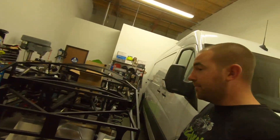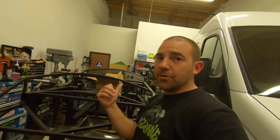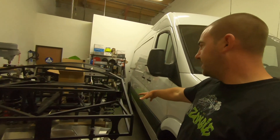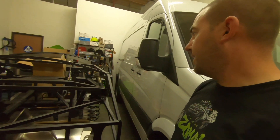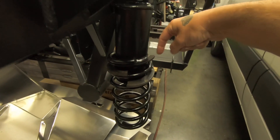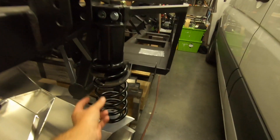In hindsight, now that I've seen this - I didn't know before - I would go coilovers in the rear. If you look on the website, it's like $500 for the upgrade to coilovers in the rear, and that's what I would do. It's just easier to install coilovers. I feel like there's going to be some messiness, and I don't think the ride is going to be as good with springs and shocks versus having a coilover setup in the rear. With coilovers you can just spin the perch to adjust ride height.